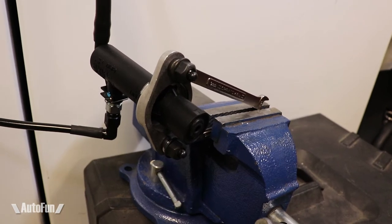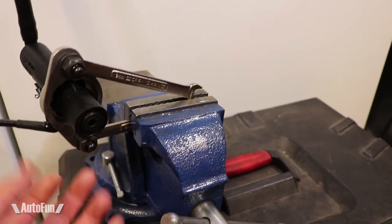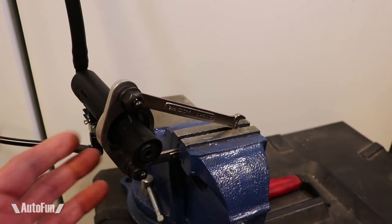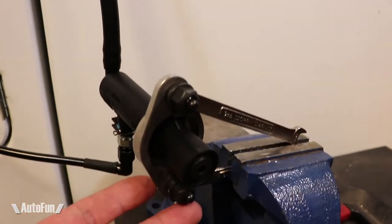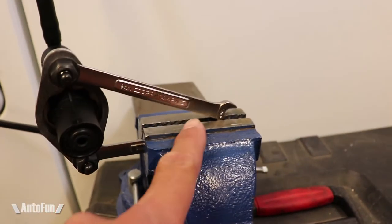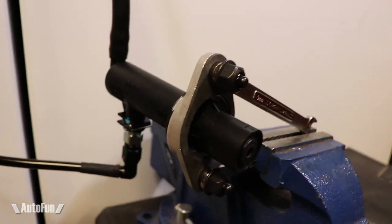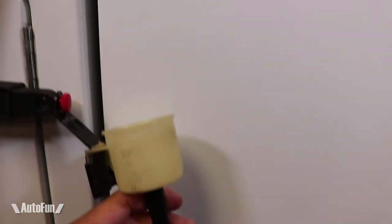This is the setup I'm going to be using for the bleed process. Normally the master cylinder can be clamped directly, but I didn't want to scratch a brand new part, so I grabbed two wrenches and put the nuts on here to hold it by the wrenches — I clamped the wrenches, not my master cylinder. It's already leaning up, so the bubbles are going to naturally want to travel up this way towards the reservoir. The reservoir is here — it's not filled yet — and I'm just holding it with a magnet. It's going to be filled with fluid right now.